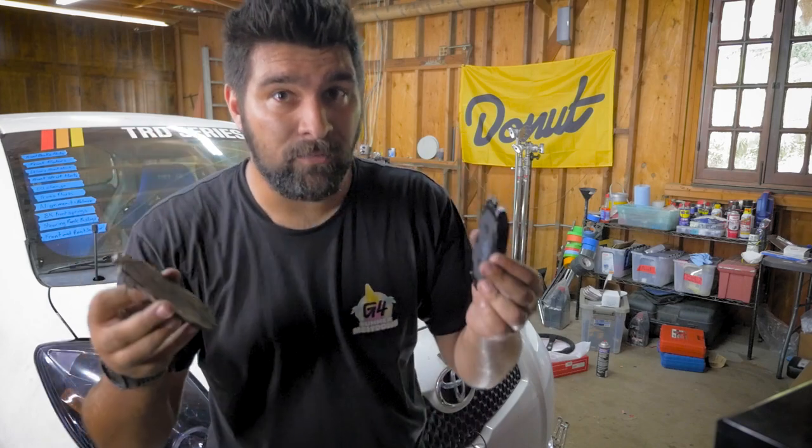Last time I checked in on these brake pads they didn't look anywhere near this bad, and I was convincing myself that the reason they got so bad so quickly was that I was getting better as a driver. But a lot of people pointed out that's not the case. What happens is as a brake pad loses material, there's less material to disperse heat from the brakes, so they heat up quicker. When you have half the pads left you might be getting less brake pressure, which means you're gonna wear them down a hell of a lot faster. So check your brakes regularly, because that last half is really like the last quarter, and that last quarter is really like the last tenth.